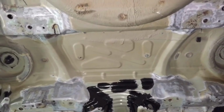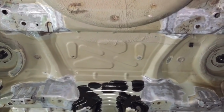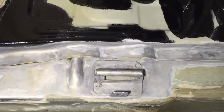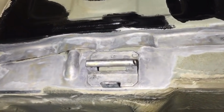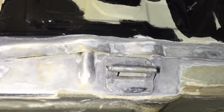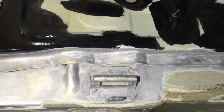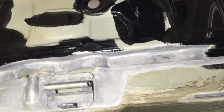We still have to do the repair and reinforcement process with the cracks on the rear axle carrier panel, which is next. Just show you an example of here how much of the corrosion we've managed to get out. And this metal, as you can see, it's looking a bit of a funny colour. That's the etching process of the Por 15 metal prep, as it's called.